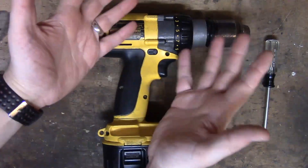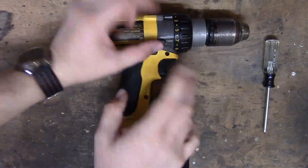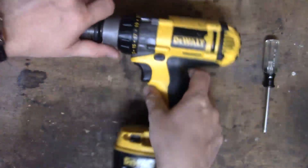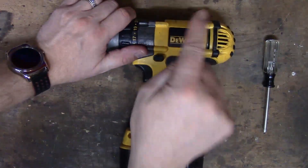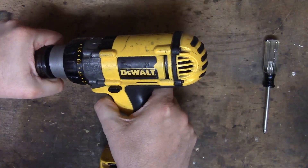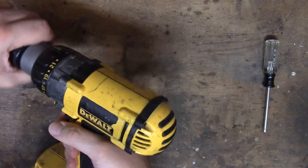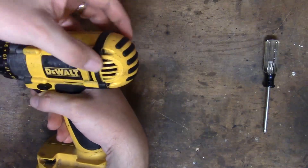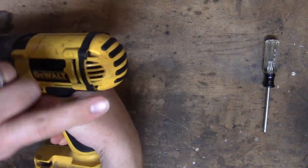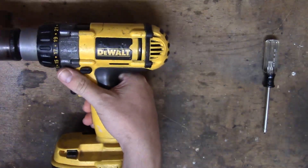What's up guys, how y'all doing? Welcome to another video. We're going to be checking out how to fix a DeWalt drill, or at least tear it apart and see what's wrong with it. I have a feeling it's the motor. Basically what happens is this thing will take off and sometimes it works good and sometimes it'll bellow smoke, bellow tons of smoke out the back. So my inkling is that the brushes and the motor are toast.